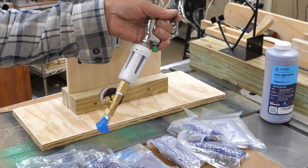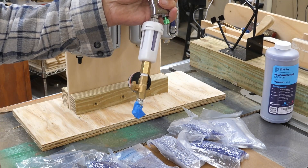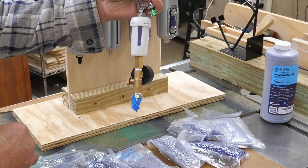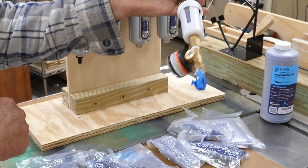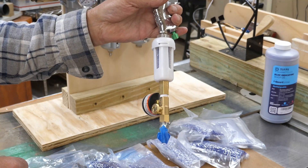When I am shooting paint, I also have another filter that I keep right on the gun, and it works pretty well. This one is starting to turn from blue to pink a little bit because it's had quite a bit of use. I keep the end of that taped and the valve shut off to keep it from getting polluted, so to speak.